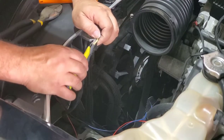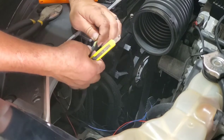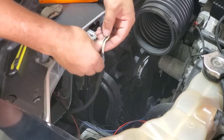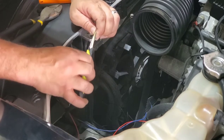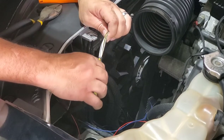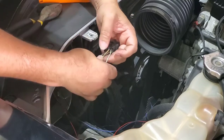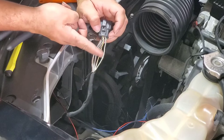Please be careful when using a knife. Over here you can see me stripping away the insulation — the wire loom wrap that the factory had over the wires. Strip away as much as you'd like; I ended up stripping about three to four inches down, which gives me enough space to select where I'll be cutting. I'm cutting wires four and five of the connector — pin wires four and five — because those are the two wires I'm going to be using to connect the LED lights.